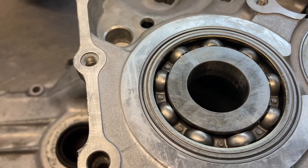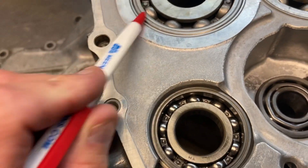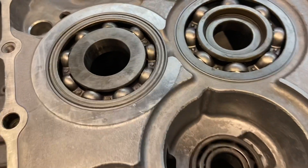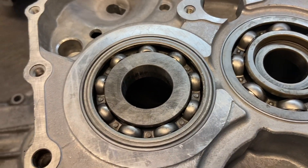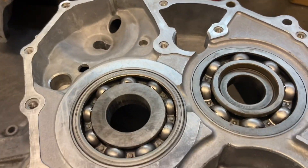This is one of the important steps when rebuilding a Honda transmission — to check and make sure that all of these bearings are properly held in the case. Even if you rebuild it without addressing this, you're going to wind up setting yourself up for a repeat occurrence of the same failure.